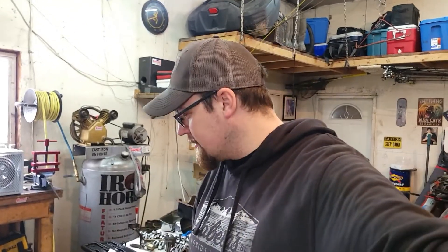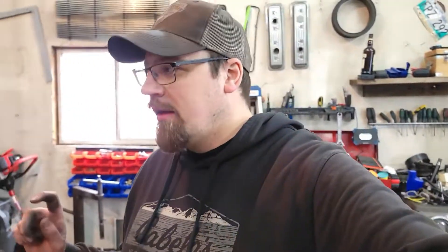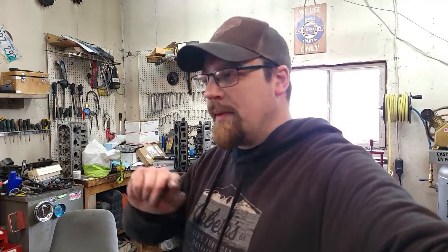Done! Isn't that crazy? Going from 63 foot-pounds to 98-100 — my mind is honestly blown. I will never build another engine again without a rod bolt stretch gauge on hand, especially using ARP fasteners where you actually get the stretch spec. Even stock bolts have a stretch spec — that's how a fastener works. I'm getting worked up, I'm excited! I think I'll cut this video off here and make another video where I start assembling the rest of the 408. Thanks for checking it out guys, I hope you learned something.